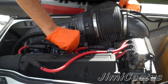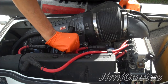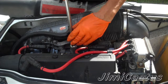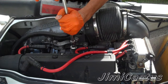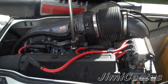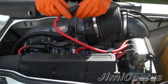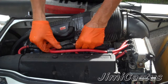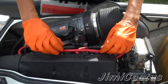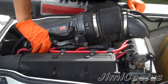This engine actually ran pretty good — I noticed just a slight popping. As with all my carbureted engines, I change the spark plugs and fuel filter once per season. When you put the top back on, keep your thumb here and press until it clicks, then put the wire back in its holder so it doesn't short out.